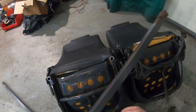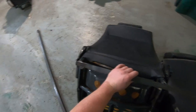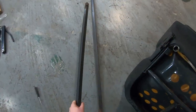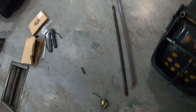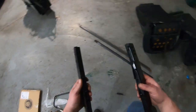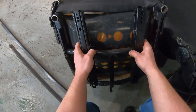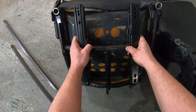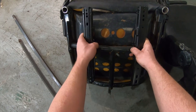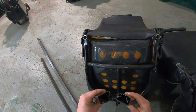The next step will be to cut and weld the angle iron on there like so on both seats. We can then assemble two of the seat runners, and then they will bolt to the back of there. We'll then be able to see how much space we need to weld a bar straight across the front. That gives us our front mounting point, and then all we've got to do is put it in the car.